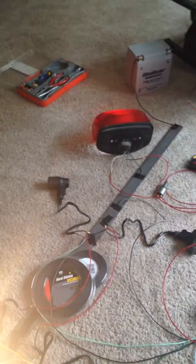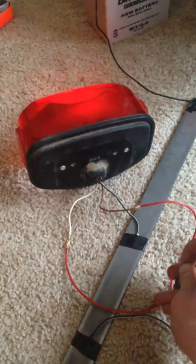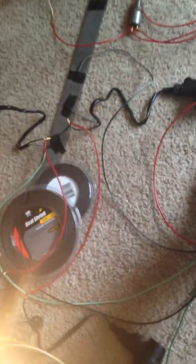I'm just showing that I've got everything set up right. Turn the key here — it's on. My running lights, I have my headlight set up so it's always going to be running. I have my brake switch in line, so there's the brake. I have the highs and lows hooked up — there's high, there's low. And then my right and left — take a right hand turn — and there's my signal relay. Take a left, here's my left hand.